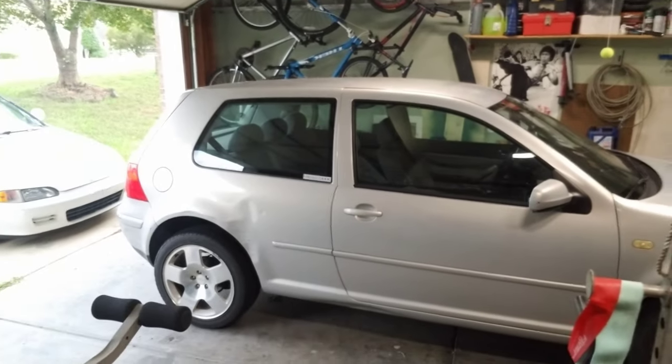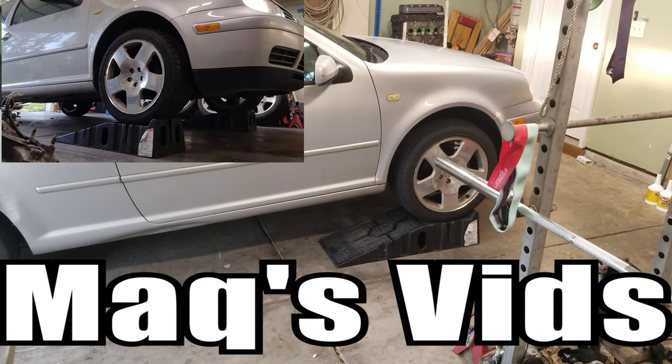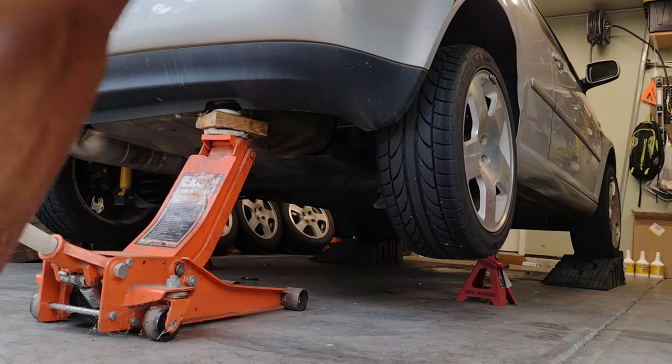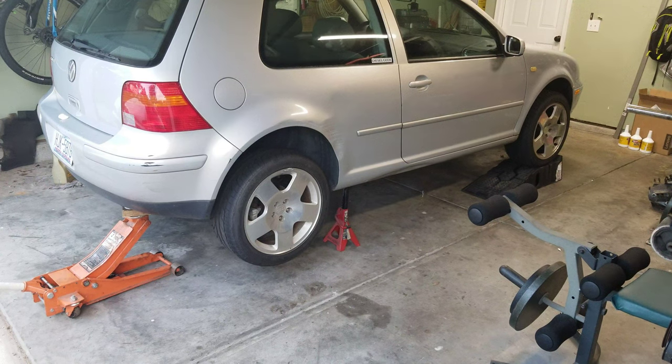Back in the garage with the Golf again. Even though I'm eager to put this into that, I need to make sure the Golf is up to the task of being my daily driver. Once I take the engine out of the Civic, I'm going to take my time and maybe do some cool things with it. That means making sure the Golf shifts better — I want carefree shifting like my Civic. I'll replace the transmission oil and bleed the clutch to see if that helps. I've been having issues with my '99 Golf — I sometimes get a grind going into first gear — and I've been doing various repairs and upgrades to hopefully make it go away, but it still happens. This video is my latest attempt.